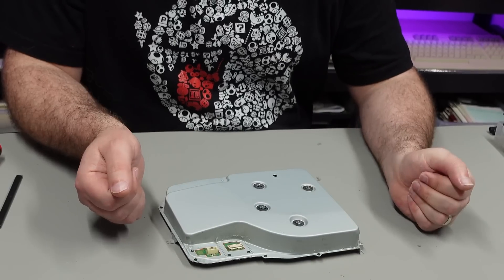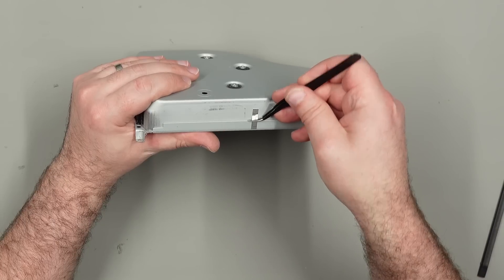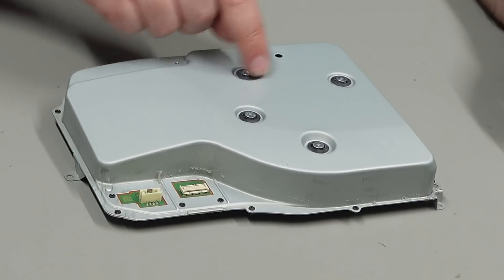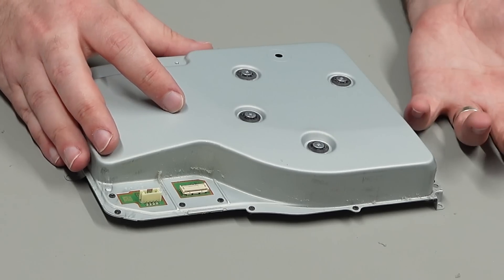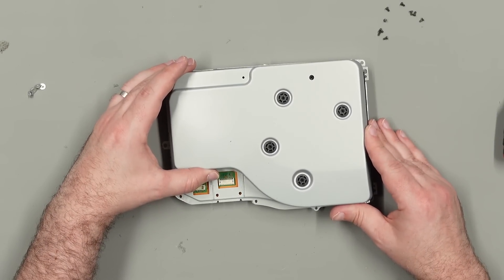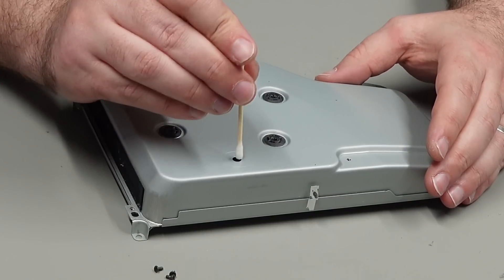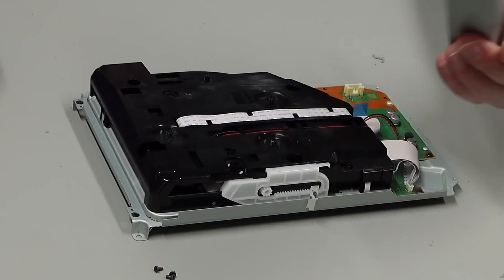Let's focus our attention on this drive. There's a little bit of foil tape here, so we'll lift that off one end. Then there are a bunch more Phillips head screws to remove, and we can now remove these four screws as well, which will drop the drive mechanism down into the bottom of the metal case. With all the screws removed, the cover lifts off. The drive seems stuck in the top cover so I'll use a q-tip and push down on the manual release button — there we go.